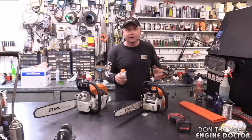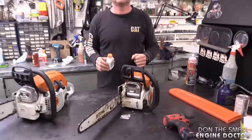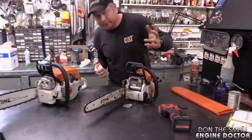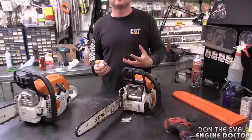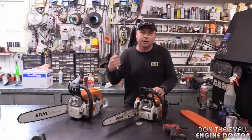If you put too much oil in your gas, you might notice some black leakage on your muffler. Or if it's poor quality oil — or oil not meant for a small engine. Don't use marine oil or snowmobile oil in chainsaws. If you did see some black leakage from having too much oil, it's because it's not being burnt and it's leaking — there's nothing wrong with your engine. What you need to do is look at how you're mixing your gas, and if you've been using too much oil, take the muffler off and clean the carbon on the exhaust port.